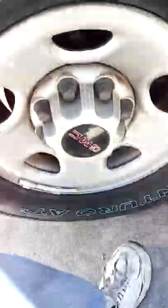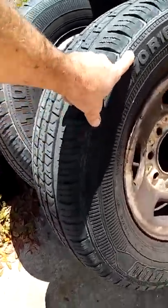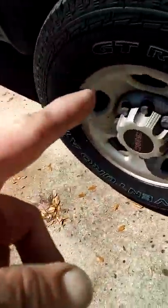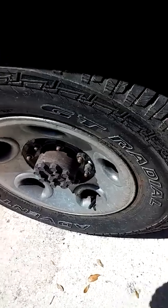New shoes for this little puppy — new uppers and lower ball joints I gotta grease. I got an air grease gun with all that equipment. There's a hell of a difference between those tires and these tires right here. These are 245 70 16 and these are 245 75 16, and these are rated E. It's pretty stout — got the same tire right here, these are only a week or two old.